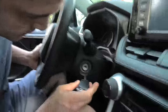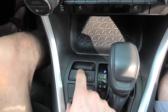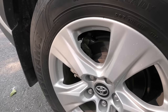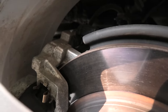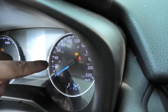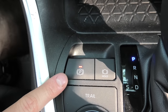Now turn the vehicle into the on position and perform the sequence: pull up three times, push down three times. As you can see, we now get a new light on the dash — a flashing park sign — and also the flashing LED on the button itself. This means we have successfully enabled the service mode.